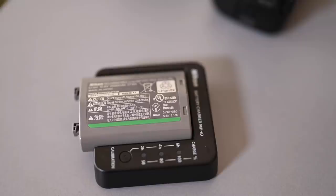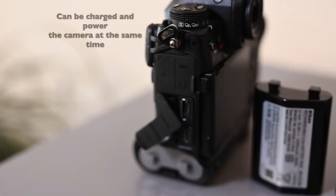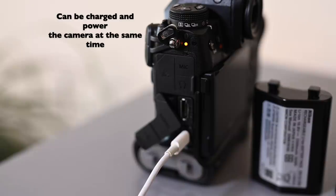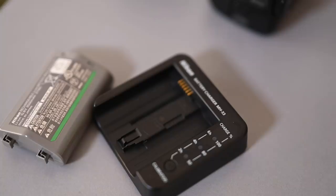There's a lot of confusion around these batteries and the charger. The MH33 charger that comes with the Z9 will charge 18B, 18C, and 18D but will not charge 18 or 18A. There's also confusion around internal charging — the Z9 can charge batteries internally via USB-C with an 18B, 18C, and 18D. The older charger from your D5 or D6 cannot charge the 18D. I'd use 18Cs if you have them, but 18Ds will give you much longer battery life.